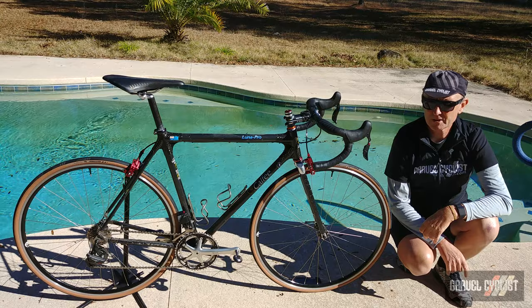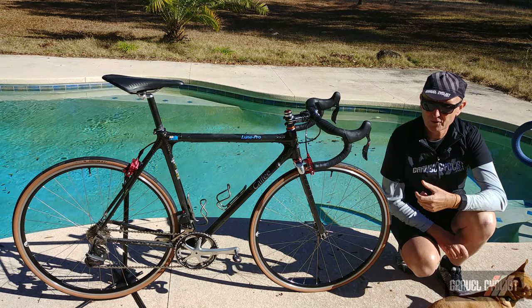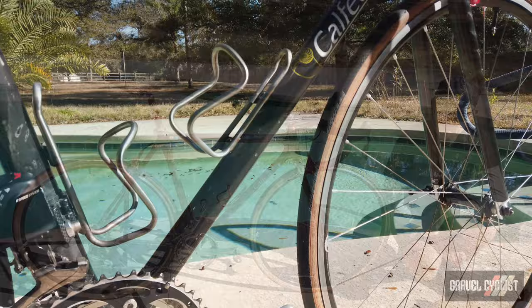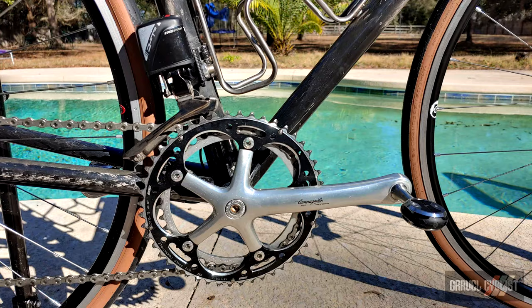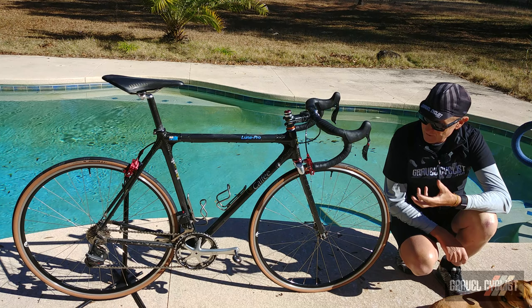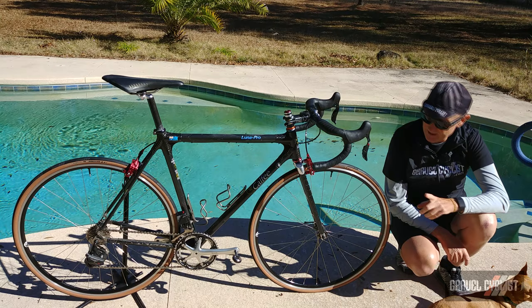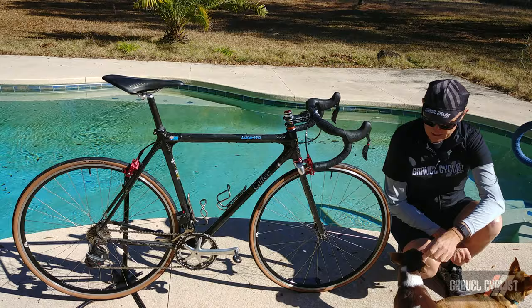This 11-speed system is paired to a 12-25 cassette, so it's a really tight cassette. There are rolling hills in this neck of the woods in north central Florida, which brings me to the chainring setup — it's by Campagnolo, namely the timeless, beautiful Record square taper aluminium crankset. These typically came with a 53-39, 52-42, or 52-39 chainring setup, but I like to run a 50 with a 39 around here. I tried something different and acquired a BBB chainring of 48 teeth, so I've got 48-39 chainrings — it's going to favour some leg speed.